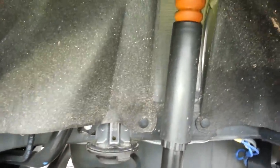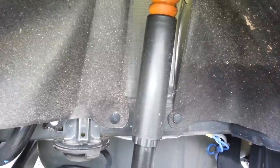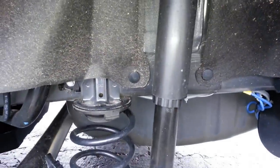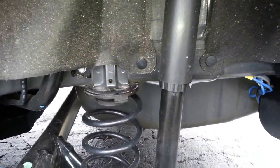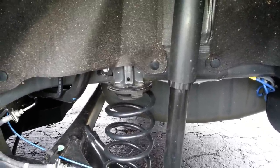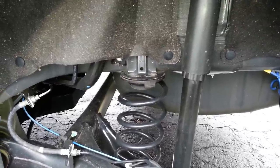I've already read some other threads on the forum that the shock absorber can be replaced with one of the Monroe air struts — I forget the exact number and I'll look for it in the description. This is the initial research phase, but I've already measured the extended height of the shock absorber, which if I include the bump stop would be around 24 to 25 inches. Subtract that out, you're probably looking at 22–23 inches, and I think that actually coincides with the previous generation models, the GE and the GD. The 2015 Honda Fit EX and all the trims is the GK style body.